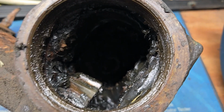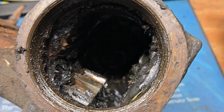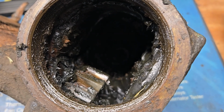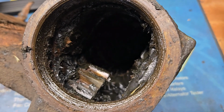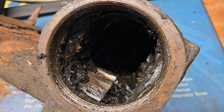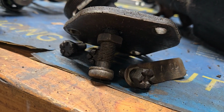Now I do want to talk about lubrication in these boxes. It is another misconception that you want to put gear oil in these. Absolutely not. Completely and utterly wrong. These boxes are to be filled with grease, and the preferred grease is a moly grease. And you're most likely going to need an entire tube to fill this thing. This is assuming you haven't taken it apart. Even if it's in the car, to refill it, it's probably going to take a full tube, so plan on that. I wind up putting these in through the stud, or there's oftentimes, oh, here we go.